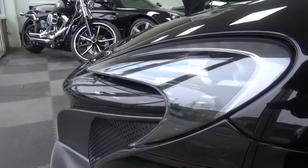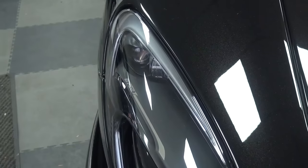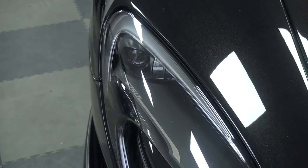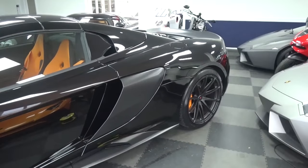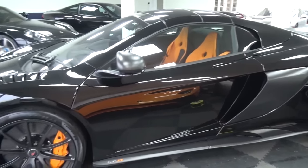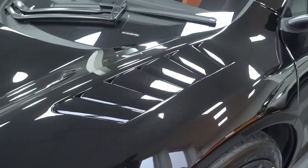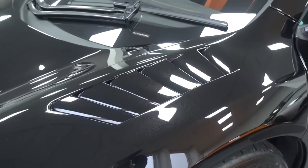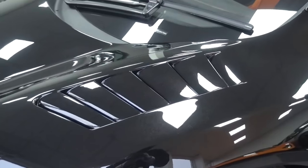There are also wheel arch louvres and a rear long-tail air brake. Above, its bi-xenon headlights are fashioned into the iconic McLaren tick, with an LED accent and 675LT inscribed below. The side louvres are options that can also be ticked on the coupé version and reduce pressure inside the wheel arch, therefore aiding turn-in.